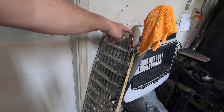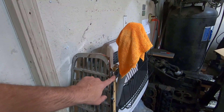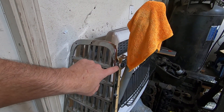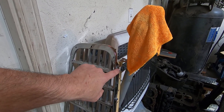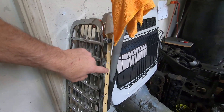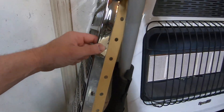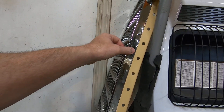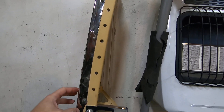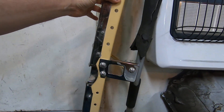I'll start with the grill. This is a reproduction chrome grill and I ended up having to drill and tap it — I used Ring Brothers hood adjustment bumpers, they're just a little bit more trick looking. Ring Brothers doesn't make them that small so I had to drill and tap to a bigger size. I have all four Ring Brothers hood bumpers in there now. I attached the grill to the grill tie bar with 12-point ARP 10-32s with stainless steel nylon lock nuts on the back. I also speed-holed the tie bar and chamfered the holes just to give it a little detail.